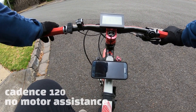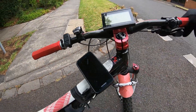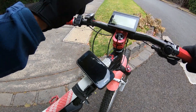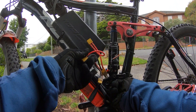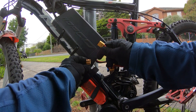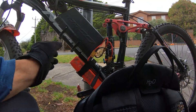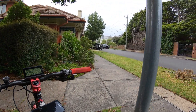Alright, so that's at 10s. I'm going to leave everything as it is and just plug in a 4s battery in series — you can see what I've done here. I've set one up underneath and made a little cable so I can splice it in. We'll have to change the menu to accept the 14s battery. This is the motor side, so I've made a plug that goes in there. This is battery one, and this is battery two, putting them in series for 14s.